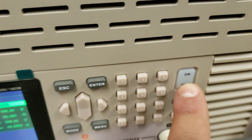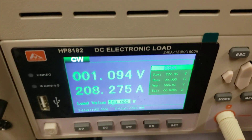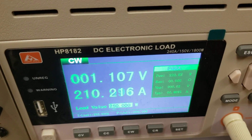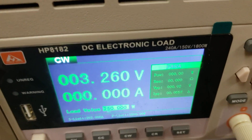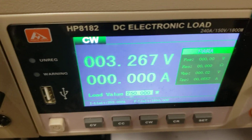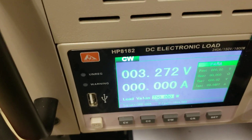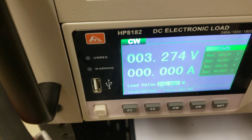I'm going to run it. And look at that — 200-something amps, voltage down to 1.0 volts. Yeah, this battery would basically puff up and pancake. You don't want to run this. So we turn that off. As soon as you turn it off, look how the voltage just magically goes back up as if nothing is going on. If you just look at the voltage readings on these things, you're being completely misled.